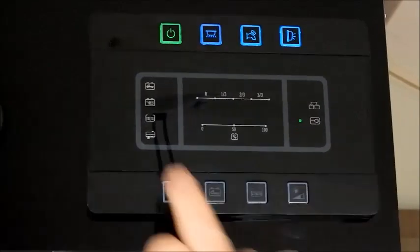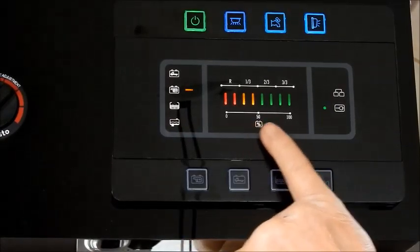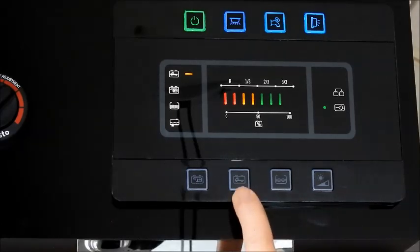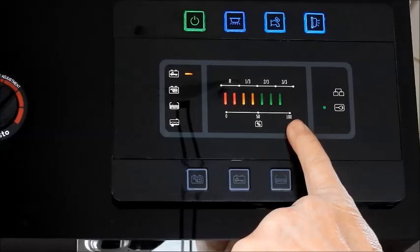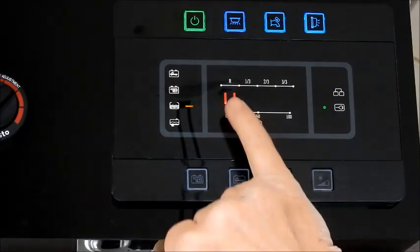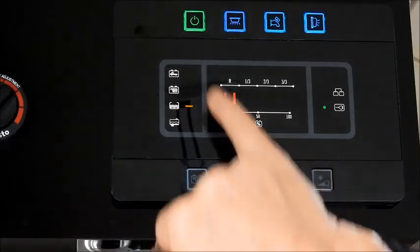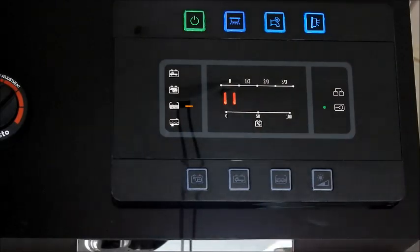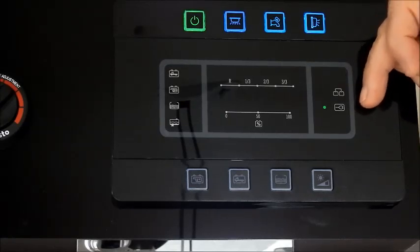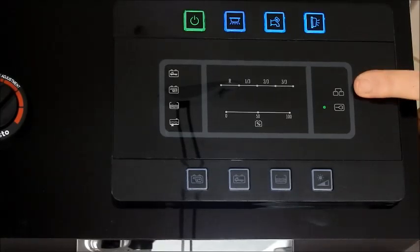Then dropping down to the bottom buttons — on the left side you've got icons. The first one is a little caravan icon — press that and you can see the lights starting to light up all the way across. That's telling us we have a fully charged leisure battery. The next one down is the vehicle icon, telling you about the engine battery — showing a fully charged engine battery. The next one is for your water, showing the tank level — we're not carrying much water, maybe about 10 litres. And then finally the last one is just a dimmer switch for the control panel itself, because at night time it's quite bright, so if you're in your bed you can turn it down a bit. You've got two marker lights — the bottom one with a green light is telling you that we're hooked up, and the top one will flash when you have low voltage or there's a fault, or one of the fuses is gone, and that will flash or light up red.